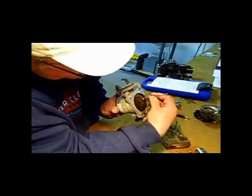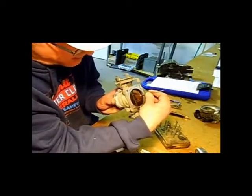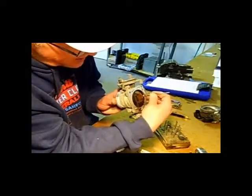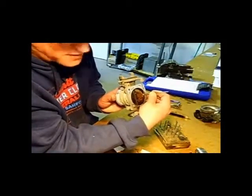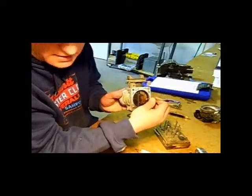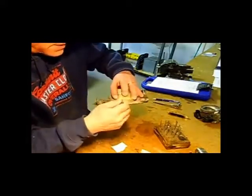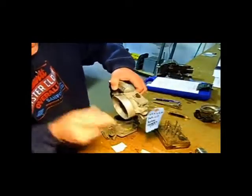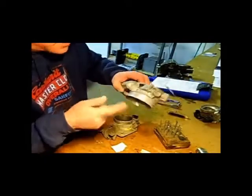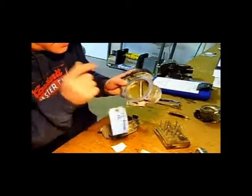And if you look, you can see that all of the cutting surface is contained within the throttle body itself. If the bit rides out where the edge of the groove is going to be outside the throttle body, then you've got too large of a bit. So go down to the next size smaller. That is all there is to it. Okay? Don't worry about cutting through on the outside. We've already shown you how to handle that, like with this one right here. Use a flashlight, go inside out and outside in wherever you suspect there might be a leak. Hold it in the dark, use only your flashlight, and then cut it.